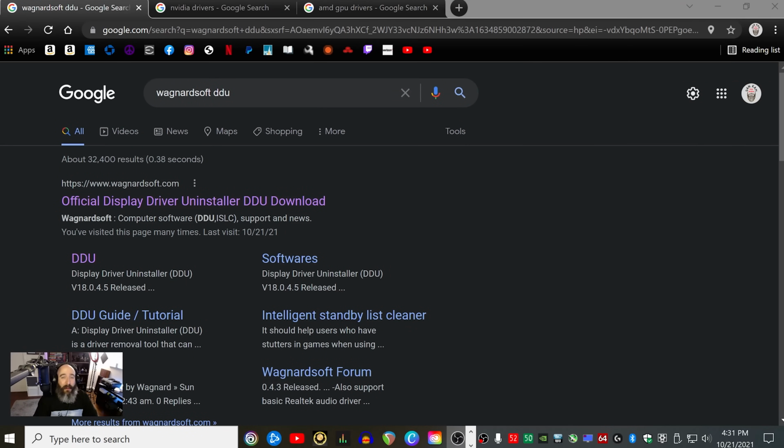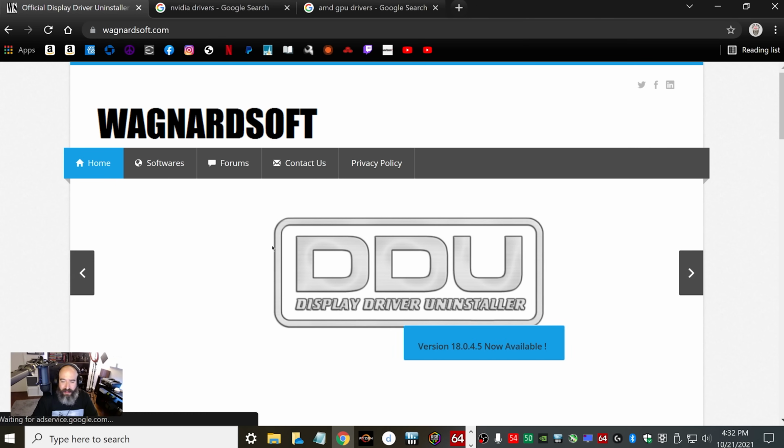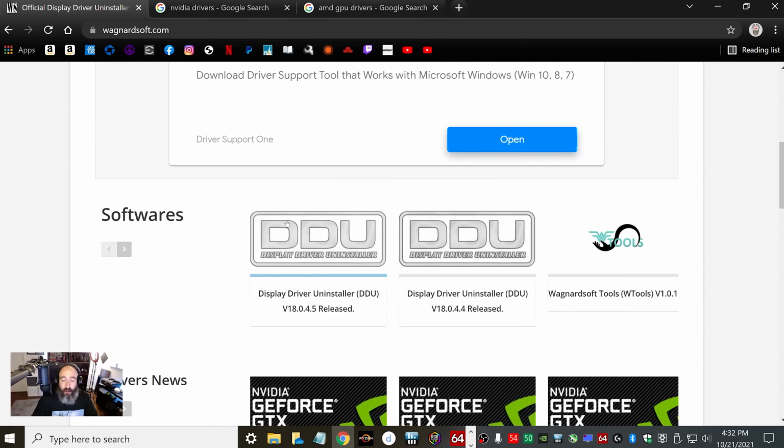All right, guys, so before we physically install our new graphics card, we have to prepare our PC for the new GPU. And the way we do that is you're going to go to your browser of choice, and I use Google Chrome. And what you're going to do is Google Wagnardsoft DDU, and the first result should be the official Display Driver Uninstaller, DDU. It'll take you to Wagnardsoft's website, so let's click there. Then let's scroll down a little bit and click the first option under software.